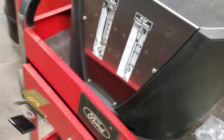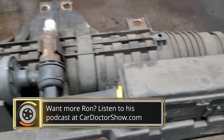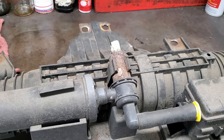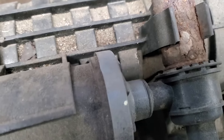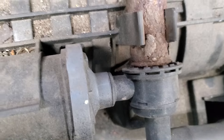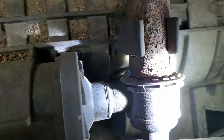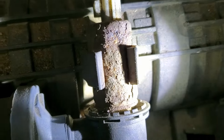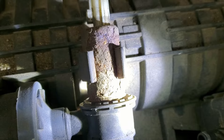My little pressure indicator is coming down, but it's taken a while — I'm filling up the vapor canister which I've removed from this truck. I'm looking for an evap leak. I saw this when it was on the truck and it's right around this area. As it works its way through, it's going to start to smoke. Let's see if we've got anything yet. I sort of suspect this could be the vent solenoid. Look at that — that vent solenoid's definitely seen better days.